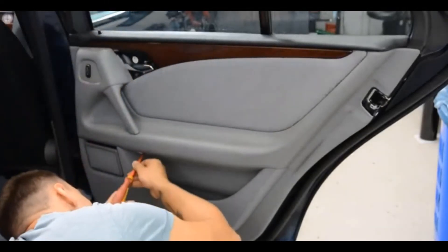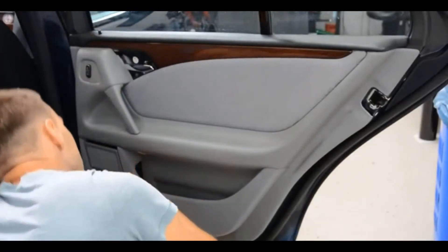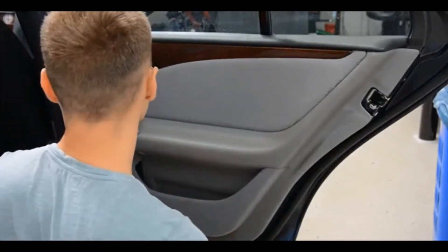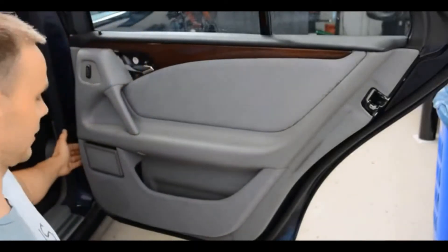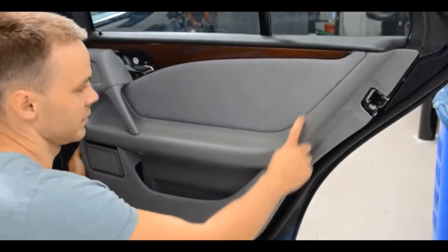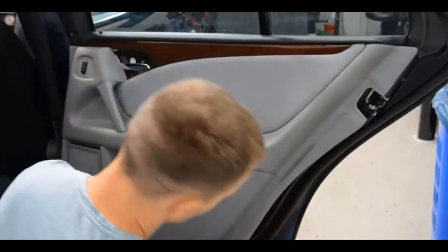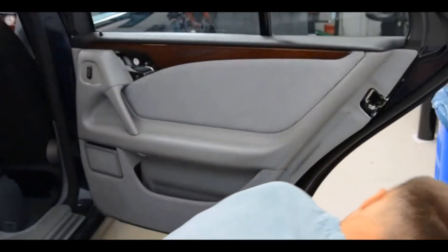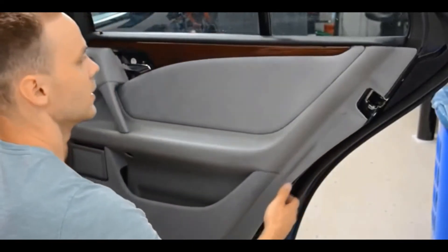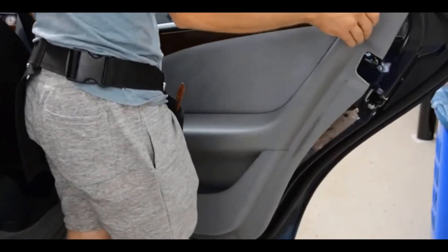Now with a good firm pull, or using your plastic tool, you can remove this panel, hopefully keeping all the clips in place. You may need to buy some replacement clips — I'll put a link in the description — and they go all the way around and you'll hear a pop. Once in this position, resting on the top lip, lift it upwards to unclip it.